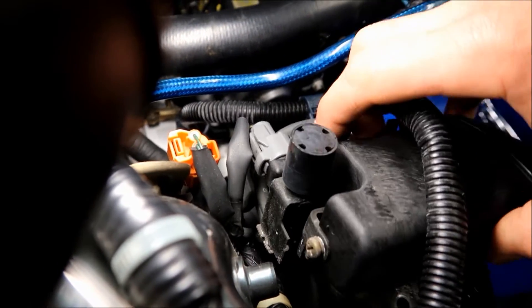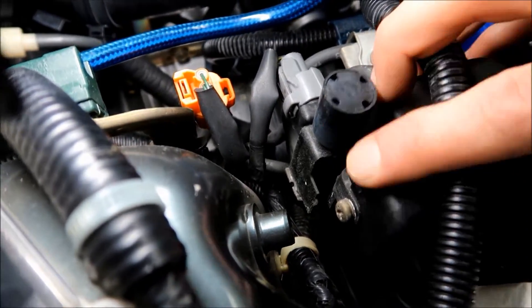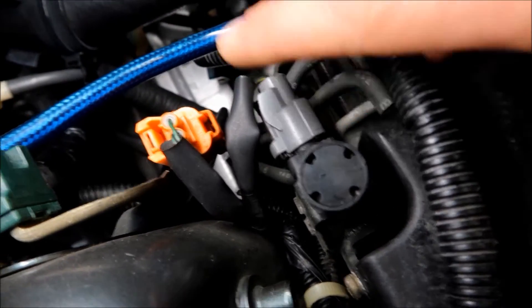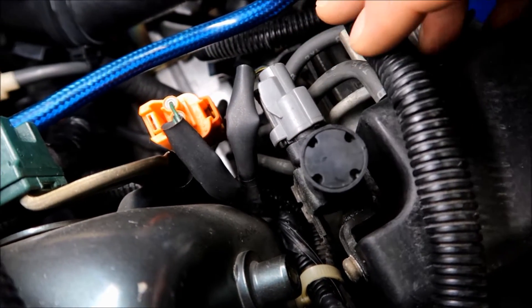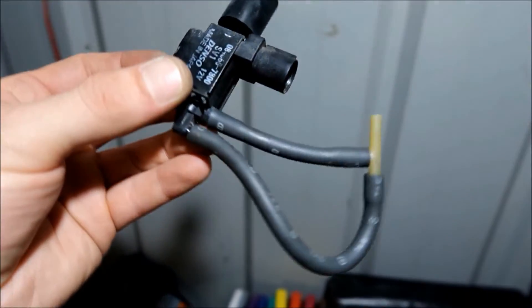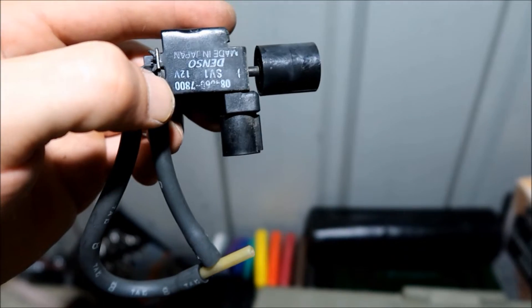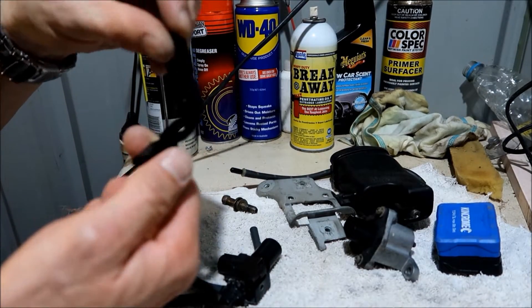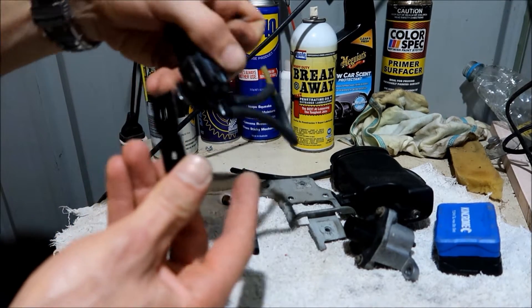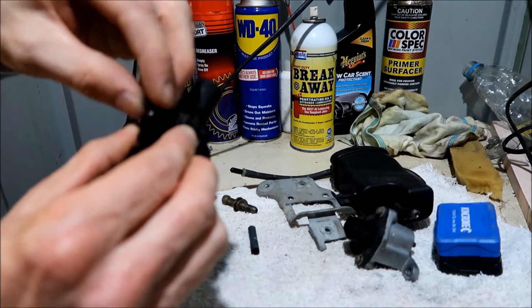Got the battery out and everything, taking a couple of screws off. The sensor is just here — unclip that, there's a screw on the side, unscrew that. You have to leave the sensor there because it's connected to the ECU — the ECU will know it's been disconnected. With stock ECUs, unless you want an engine check light or to go into limp mode, you have to leave this stuff here. It's all replumbed — plug this back in, put the vacuum line back to the intake and the ECU shouldn't be any wiser. I've already prepared an L-shape bracket, painted it, and I'll show you. Stick this in the back, get the same screw you took off and screw it back in. She's all back together.